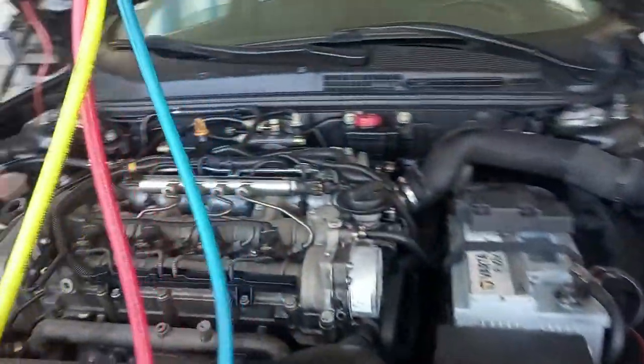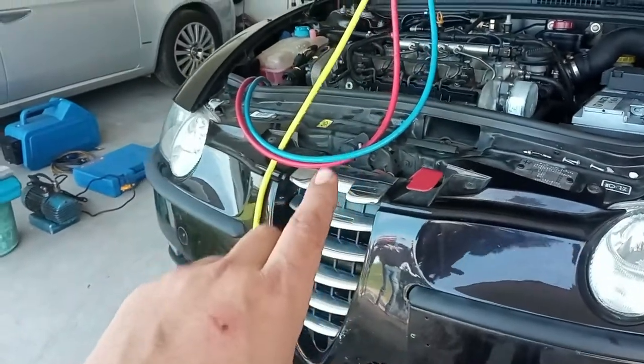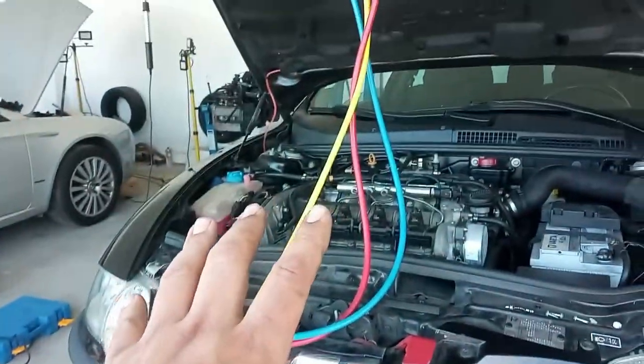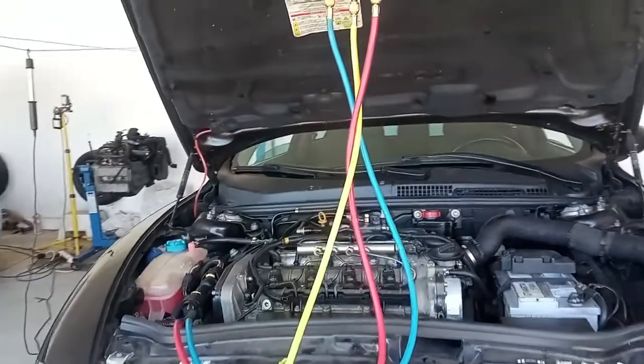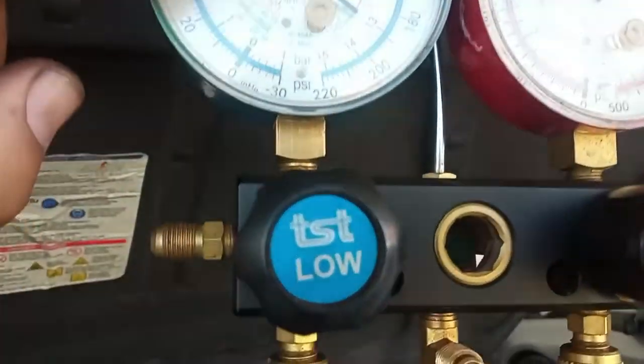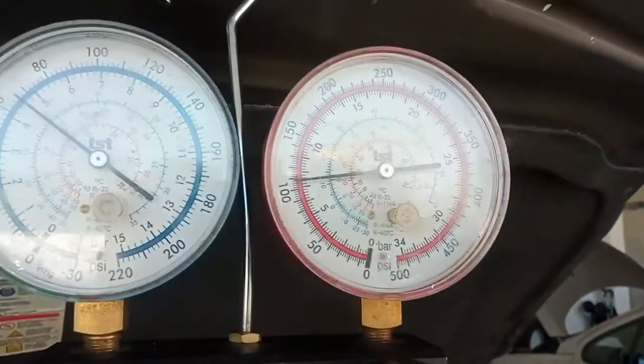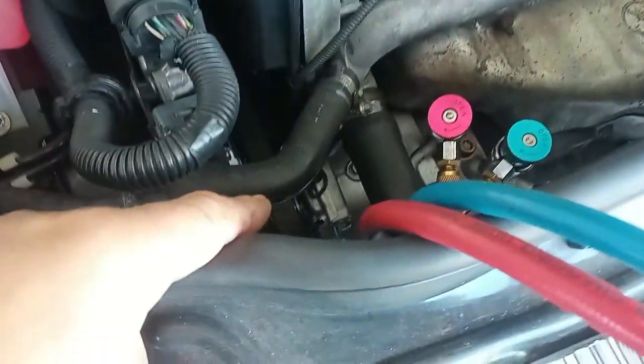Namely that check valve that we have on the back side of the compressor, like you saw in the previous video. So this is very interesting. The compressor just failed on us. I was doing the Portuguese version, I saw that the low pressure was starting to rise just a bit and the high was starting to drop, and I knew something was up. So beware,